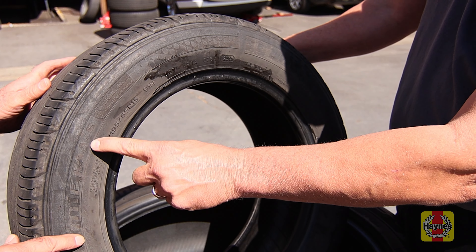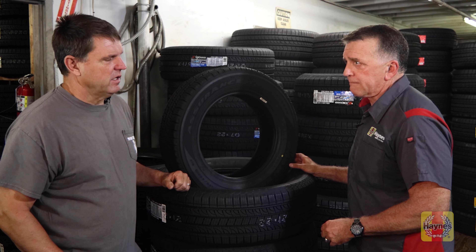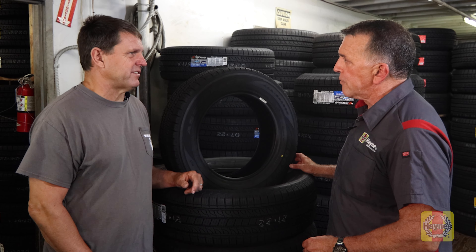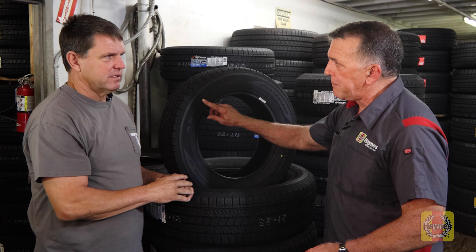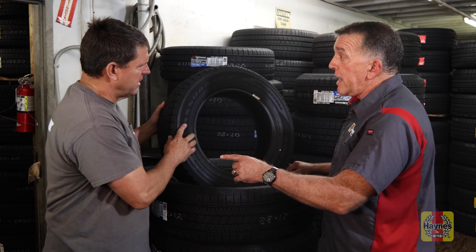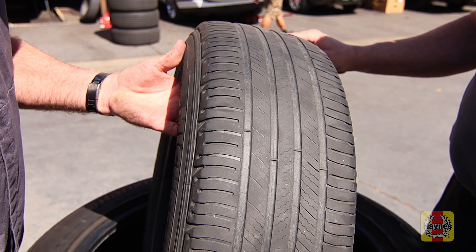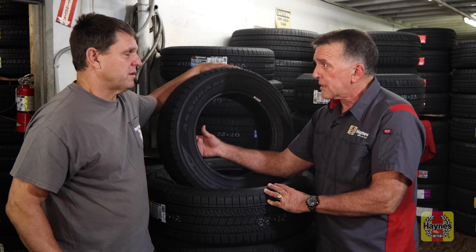Please talk about what you tell your family to do inspecting the tire. When you stop for gas, walk around and look at the tires. If you ever see a bubble or bulge in the sidewall of the tire, it's done — you've ruined the tire. If the tire is more than five years old, you need to start getting new tires. Five years is the maximum tire life according to tire professionals. Tires don't necessarily look bad on the outside when they're going bad — they can crack from the inside out where you can't see it.